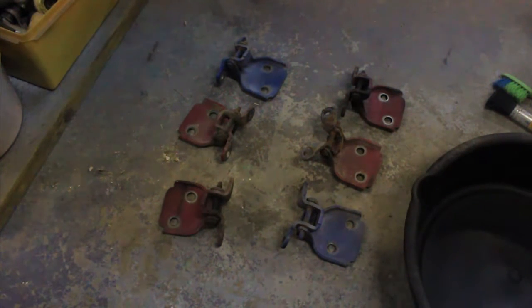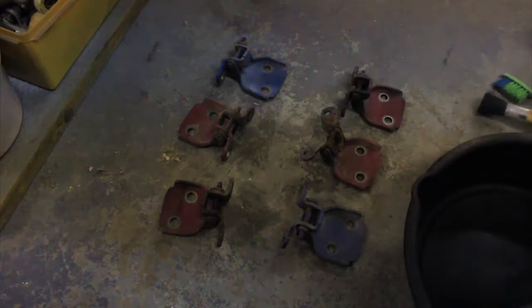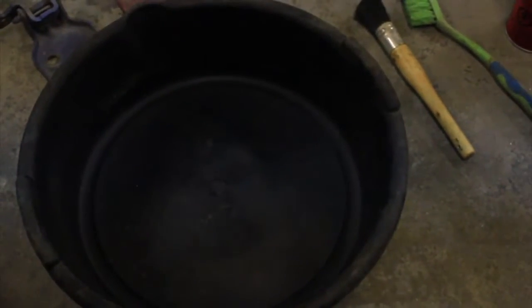So basically I should have good hinges. Right now I'm just going to get them into a bucket, use some brake clean and brushes to clean all the grime off of them before I stick them in my blasting cabinet and blast them. Let's get this set back up and show you guys my process of cleaning.